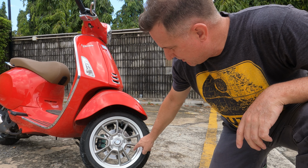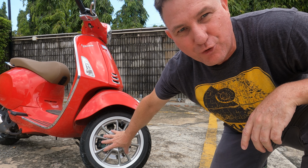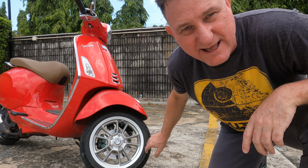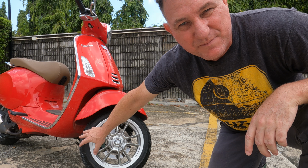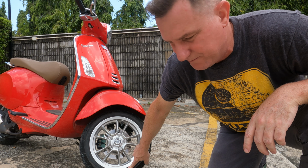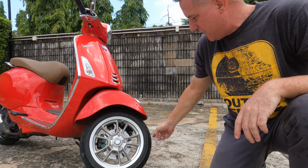So on this tire, on the approach, I'm looking for any excessive grime or buildup, too much dust or any kind of brake issues. But then I'm looking at the tires. First of all, checking the tire pressure. With a simple kick, you can work out, yeah, there's air in that tire, I'm ready to go. But with a visual, I can also see if there's any kind of nails or tacks or screws. I'm also going to look at the wall. I can see on this tire there's actually a few cracks on the wall of this one. So I'm going to take this to a tire shop, get them to have a look at this and see whether I need some new ones, because tires do wear out.